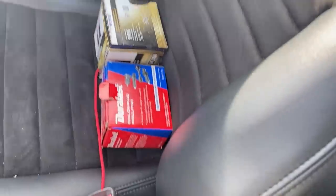Today we're a little bit all over the place. We're changing the oil in the Duramax and I also needed to run to the parts store because the misfire in the Mustang has returned, which I kind of suspected. Last time we did plugs and cleaned the mass air meter, but I'm leaning towards coils. I don't want to spend the money on a full set of coils yet, so I'm gonna try the plug boot and wire connector set — it's like 30 bucks. We'll get that taken care of, get the oil change done, then get back to drafting some parts.